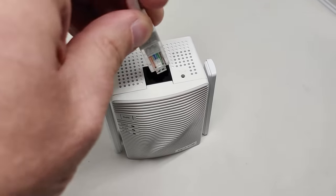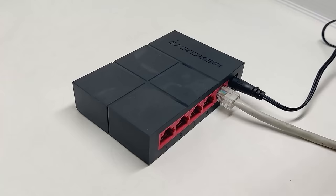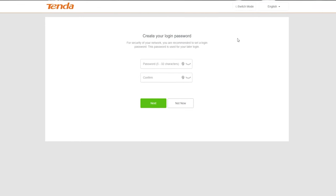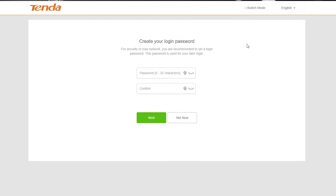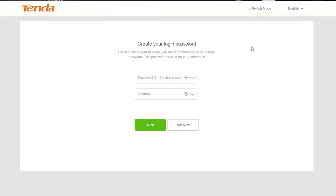So let's show you the steps you need to do on this particular model. It'll be the same on most of them — the ideas are the same, obviously the interface will be different. The extender is plugged into the mains, and there's also an Ethernet cable plugged into the extender. For this particular model, you still have to connect over its Wi-Fi network to do the administration. So I've connected to the default Wi-Fi network, which was 'tenda_ext', and then there's a default URL you type into your web browser to bring up the administration interface.